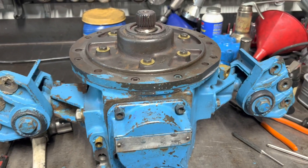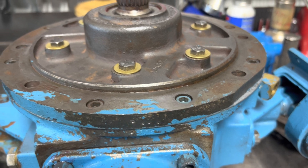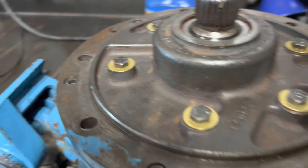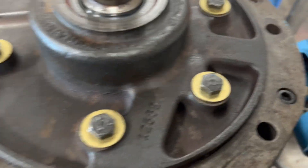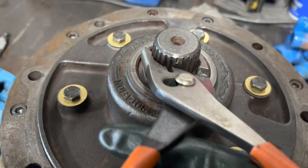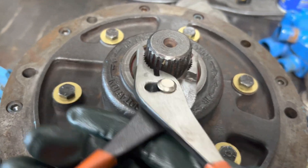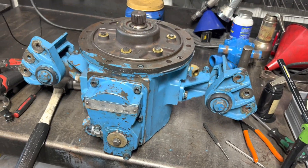Alright, I've got the base transmission together. You can see my marks - the three from the previous and then that's mine - so this is for right-hand rotation. That says up for right-hand, so it turns, and we've got the pump engaged. That's good. Now we're off to the V-Drive portion.